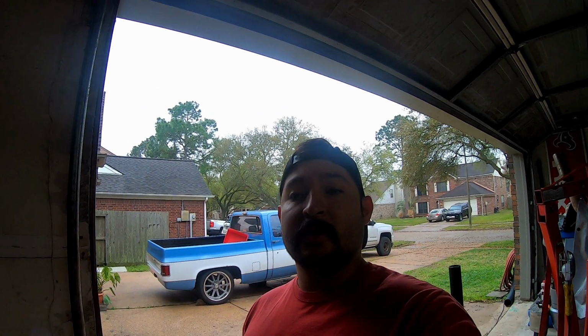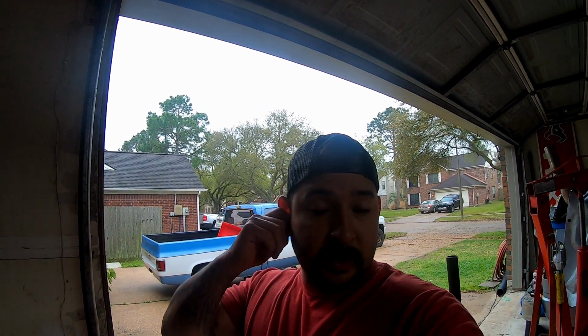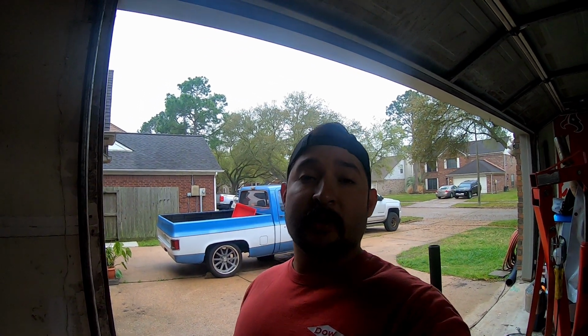What's up? It's Tuesday morning. Obviously I didn't get done all the way. Stayed up till probably about 1 or 1:30 finishing this thing. I did do the flywheel. I put the converter back on, transmission's back on, the drive shaft, and then the H-pipe for the exhaust is back on. I've got everything put in place the way it needs to be, with the exception of the starter. I still need to shim it, and then I can top off the transmission fluid and take this thing off jack stands so that we can drive it around.